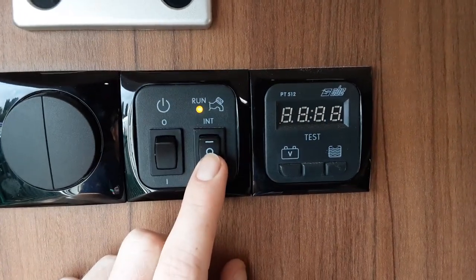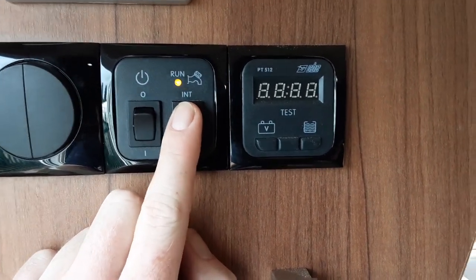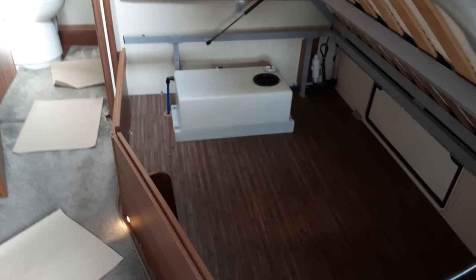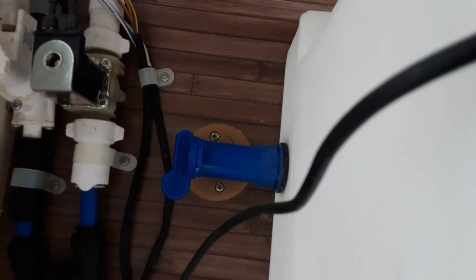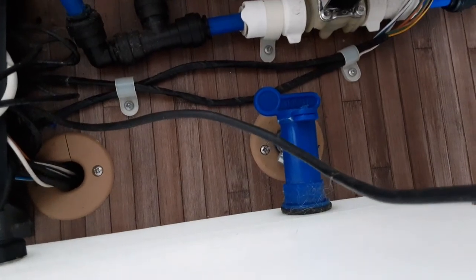You can either run from your external supply — the aquaroll on the outside — so you put this switch downwards and that will allow the water system to fill up from the aquaroll on the outside. Or you can put it to the internal tank and it will fill the onboard water storage tank in the back of the caravan. If you're going to fill that tank, you need to make sure the valve on the side of the seat is in the closed position, because if you put the blue valve circle piece to the right-hand side it would actually drain all the water out of the onboard water tank, very similar to what the yellow valve does at the front of the caravan.